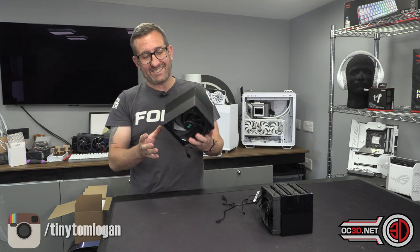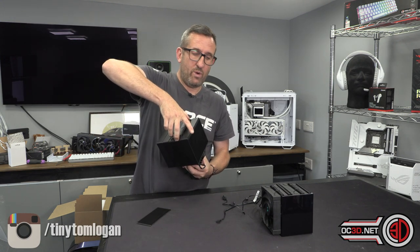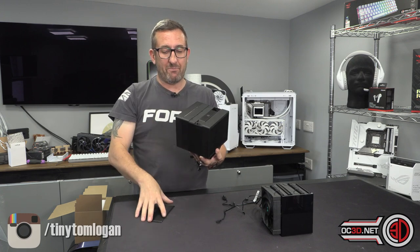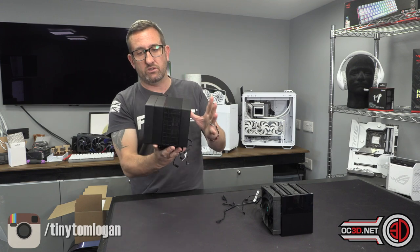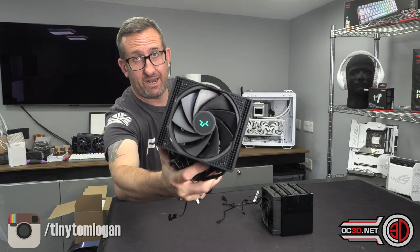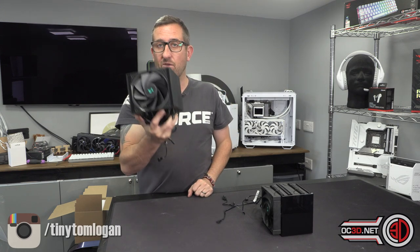The Assassin is a twin tower cooler. There is a 140mm fan in the middle which you do need to remove for fitting — to be fair you have to remove the other one as well. It has a funky layout and a very confusing fan. That fan on the outside is an exhaust despite the lack of frame — it is a reverse bladed fan — so when you fit it you do have to be careful.